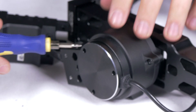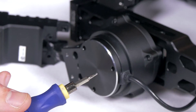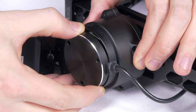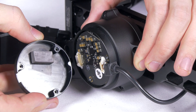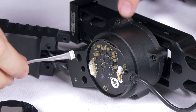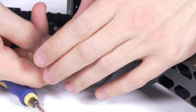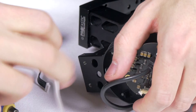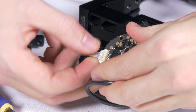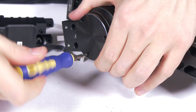Use your 1.5 hex Allen key again to open up the middle motor electrical board compartment. Remove the three screws holding the cover and gently pry it off. Keep in mind that the board will be stuck to this cover. Here you will find one end of the cable. Disconnect the old cable and connect one end of the provided cable, taking care while removing the connection sealant. Insert the cable into the motor module compartment and plug it in.